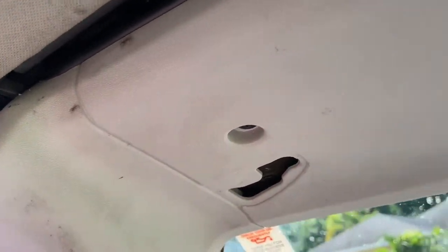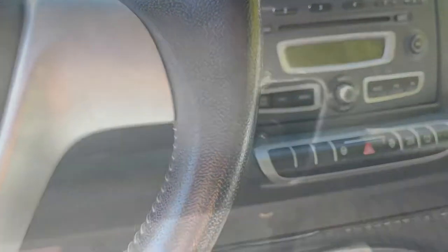We're not going to pop it off yet because I want to remove this rear spoiler first, which is these four screws across the back. That'll give me access to the little motor. These are the spoiler screws - I'm inside the trunk looking up, lying on my back. I think they're T25 - yeah, they are - and we're just going to take out the four screws.